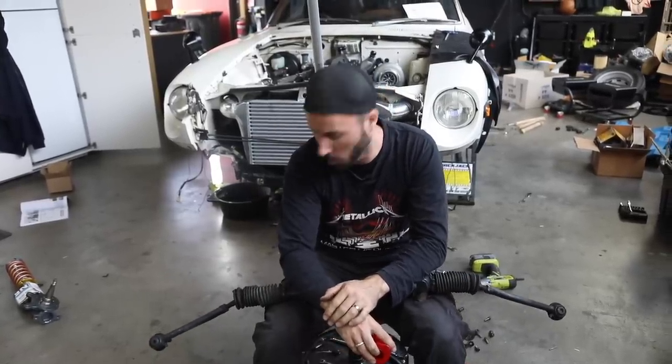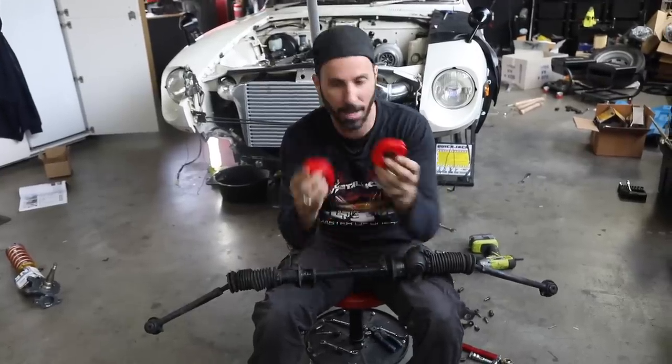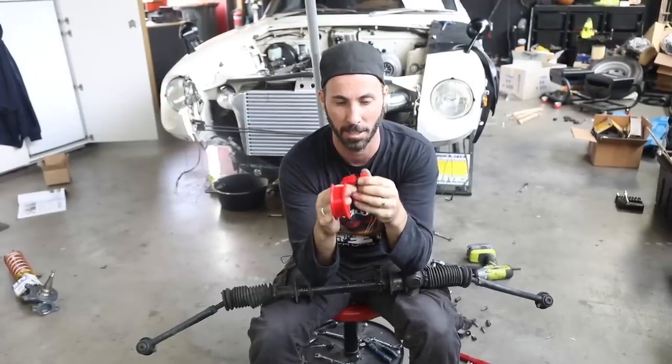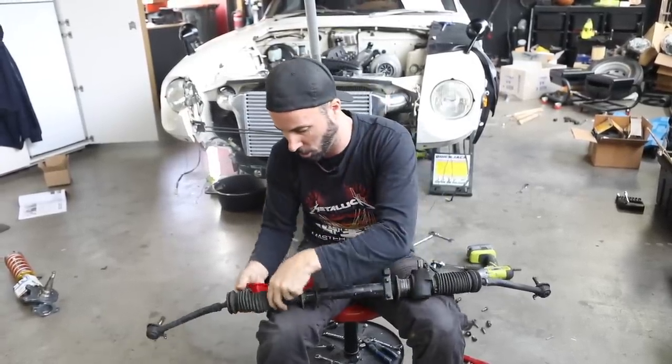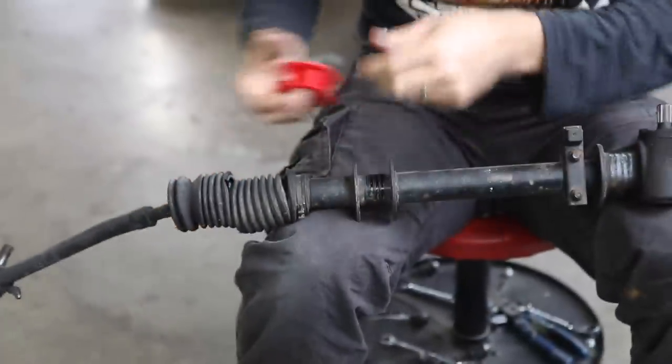The R33 brakes that were on the front are getting replaced with a Wilwood set. We've just taken out the steering rack because we need to replace the bushes — we've been putting this off for weeks because you kind of have to undo the engine mounts and jack it up a little bit. These are the steering rack mount bushes. The boots are also all torn and rooted, so we've got to fix those up.